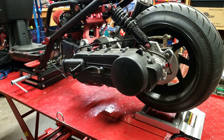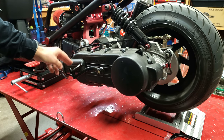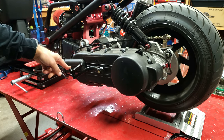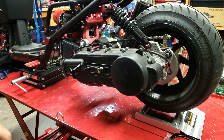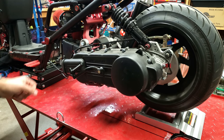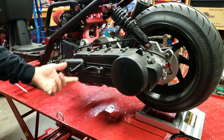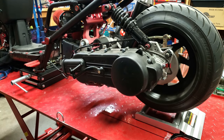Here's how the transmission looks currently. I got the case here and then the kickstarter. One thing when you put the ankle biters on is you do remove your kickstarter, so make sure you have a good starter and good battery because if they fail then you can't start your engine. We'll start by getting a 10 millimeter to get the kickstarter lever off, then a bunch of 8 millimeters, and then pull this cover off.